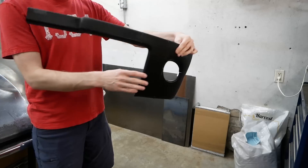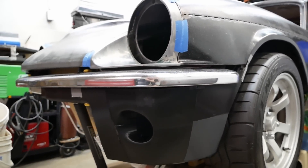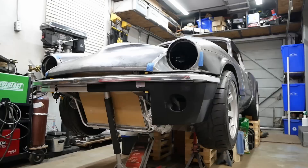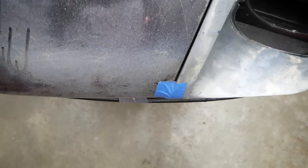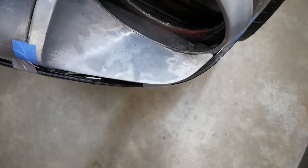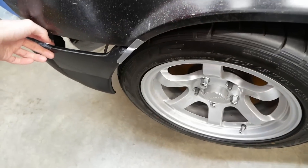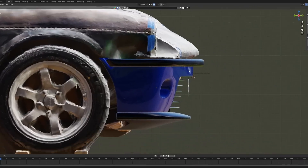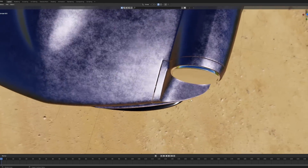With them secured together, we can now at least hold it up to the car and see what's what. On the whole, this is so close to what I've been looking at on the computer — it's actually bizarre. What a crazy process, and my brain's already rambling on how many other things I can use this for. But there are some fitment issues: we're sticking too far out up front, on the side, and not far enough under the headlight bezel. The shape of the grille opening should be angled out a bit more to tie in with the hood's real profile, and as there's plenty of tire clearance, perhaps I could sneak the profile back in just a smidgen. It turns out my original model was off by several inches up front, so I've taken the time to correct the difference, and we can now make all the necessary tweaks to the prints.